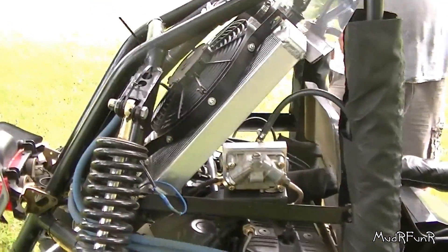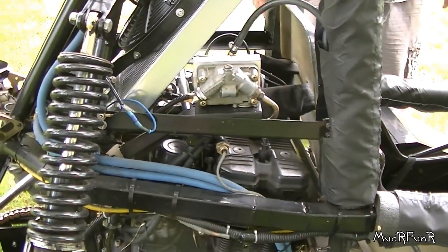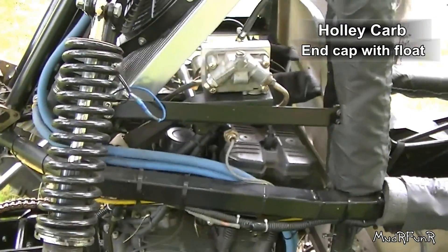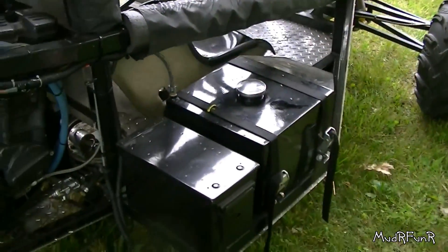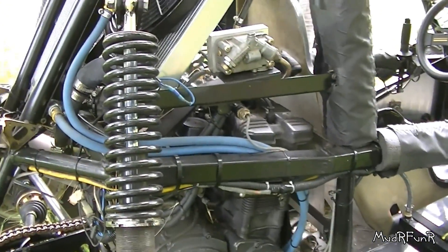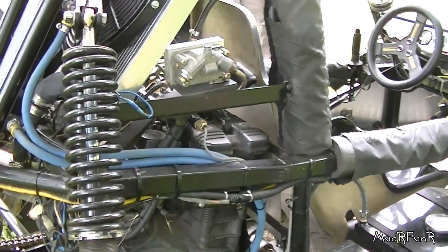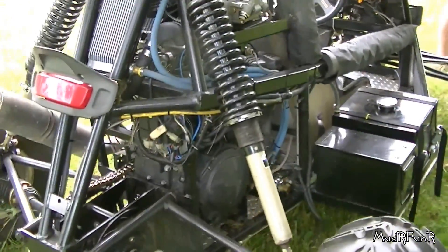It was the only place. So that's simulating the tank on top, because it's just gravity feed to the carbs. I was always dumping too much pressure in. That just came to me one night — take the end off of it. Because I had a small Coleman tank that I was using a diaphragm pump to pump it up and then just let it gravity feed back down to the tank so it was always circulating. But that didn't work. Every time I'd get onto it, it would pump too much and it would just start dumping out the filters.